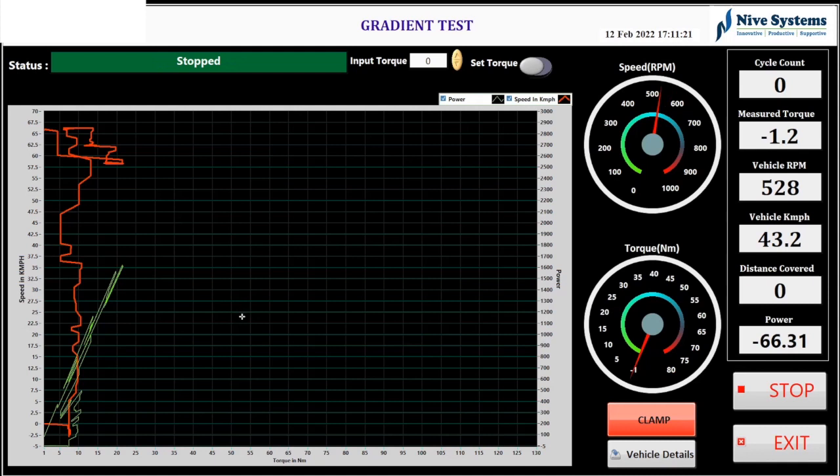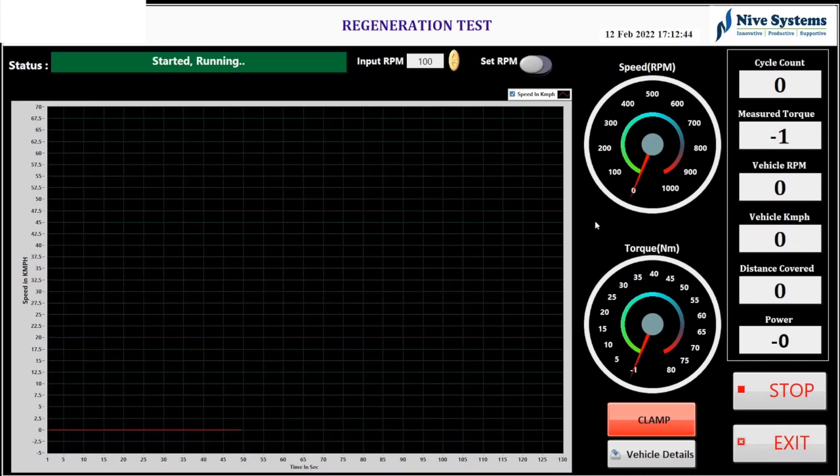The system is controlled on and off by a limit switch. The regeneration test is a downhill process test. In this test, the vehicle is kept in idle condition and the motor rotates at speed modes — 100 RPM, 1000 RPM, and 2000 RPM — to check how much battery charge is gained. The vehicle rotates in a clockwise direction while the motor rotates in an anticlockwise direction so that the vehicle gets charged. SOC percentage, DC current, and DC voltage are obtained through CAN data from the vehicle controller. Gauge indicators display real-time RPM and torque values, and the user can set RPM values to check charge percentage under different downhill slope conditions.